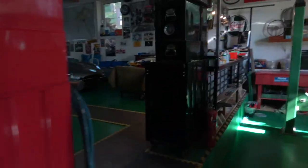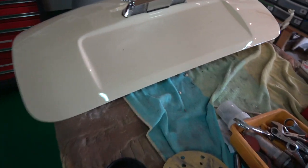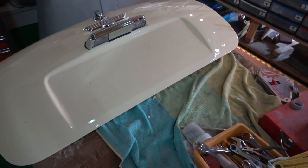The reason the boot's off was obviously to get into that. But more importantly, the same situation — it's very difficult. You can see it's starting to come through, so that's going to have to be cut back. There are a couple of places — there's a little indentation there, a little mark, a dust fleck mark. On this side there's another imperfection — not quite right there. The problem is when you've got the number plate on, the number plate holder takes your eye off a lot of these things. So we'll get all this done and then get it in for painting again.